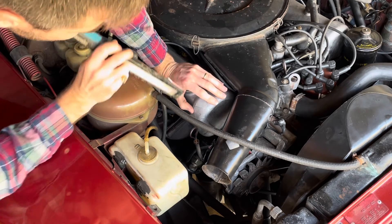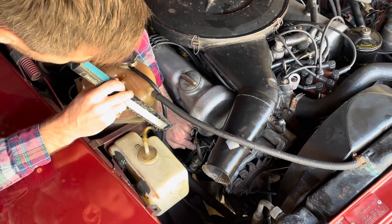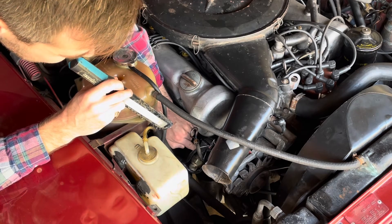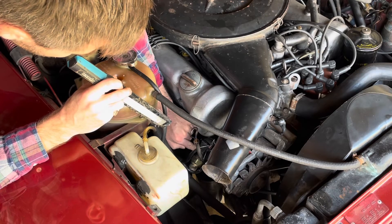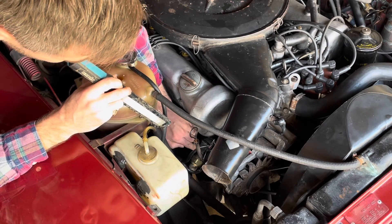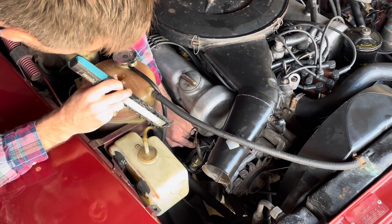I used the Febi sprocket, chain, and tensioner. Now, the later tensioner on the '80s cars — the Febi part for that has quite a bad reputation for failing, as the oil channel in it is prone to failure and loses oil pressure. However, I had a chat with the SL Shop about the earlier Febi-style tensioner correct for these cars, and they said they'd supplied plenty and would happily use it in their workshop. With online research I couldn't find complaints about the earlier one — it looks like a chunky unit, so I was happy to fit it. For the later tensioner, I would avoid the Febi part based on how many complaints I've heard.